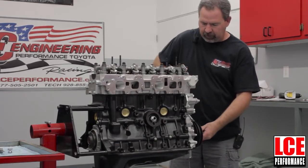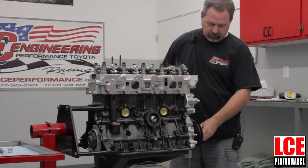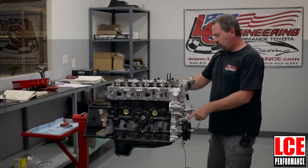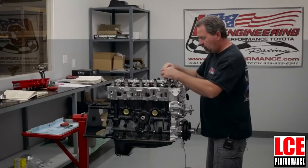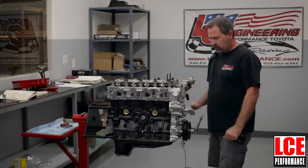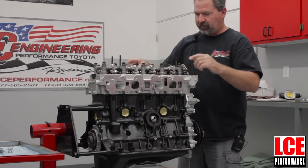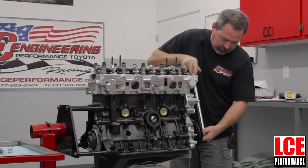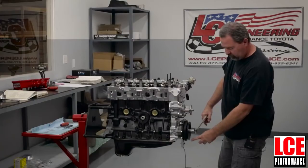The way we do it at LC Engineering — because we're usually building engines on the stand with zero lash to start from — uses the same starting point: number one cylinder at top dead center on the compression stroke. The rotor points at number one, both valves are closed completely, and number four is tight confirming TDC on number one. Adjust number one cylinder the same way. Then turn the crank 180 degrees so the timing pointer is straight down — you can make a reference mark if needed.